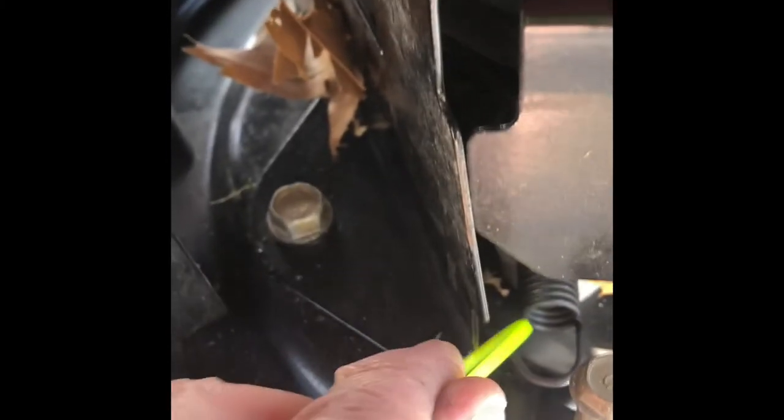I got one side of the spring out of the hole; the other side comes off that post. I've got the new spring inserted into the hole by the cotter pin on the bottom of the brake pad lever, and the other side is positioned waiting for the weed whacker string to pull it over that post. I looped it into the hole on the far side first since that was more difficult to reach, then pulled the spring around the pin to keep it in place. Remove the weed whacker string — and that's all there is to it.